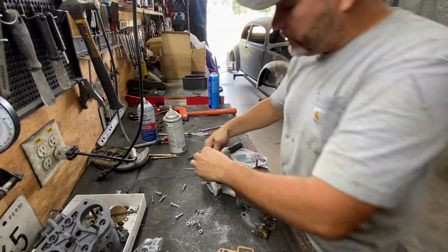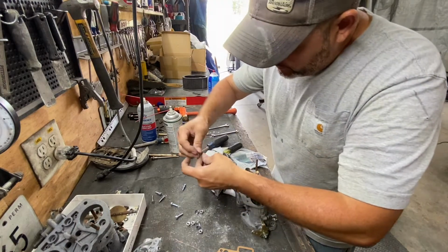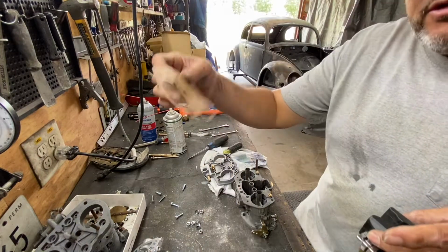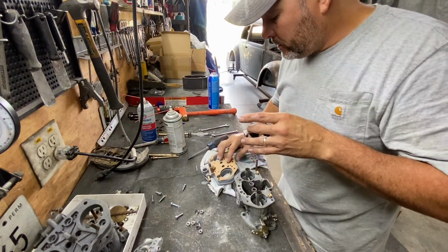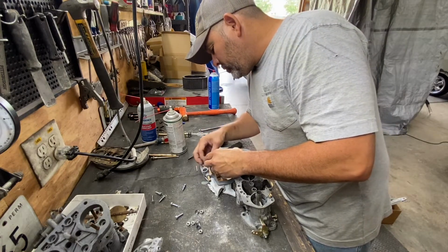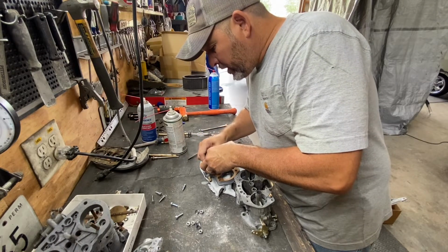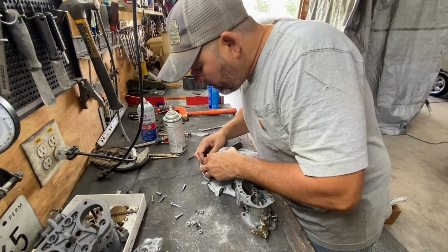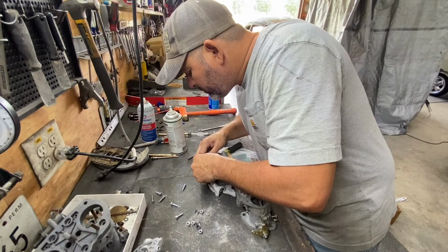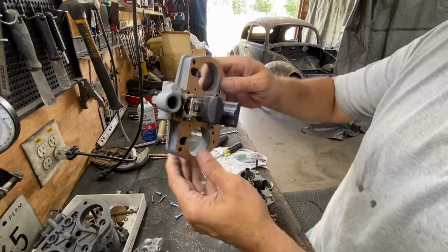You see, oh, I forgot about something. Okay, so before you put the float, you have to put the gasket in. Ensure the gasket goes and works fine. So gasket goes before the float. You put the float in, and then you put a little shaft in there. Oh, come on. There you go. Fumbling a little bit. All right. Let's see it. That's how it goes.